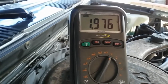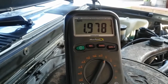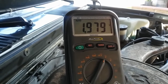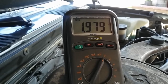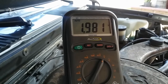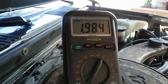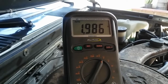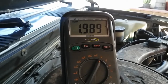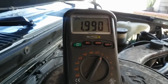That's a quick way to check if your thermistors are reading properly. Sometimes if these thermistors get heavily coated with carbon deposit, that can also affect the voltage readings because it's not allowing the thermistor to heat up properly or quickly enough. Another symptom could be a partially clogged or fully clogged EGR system that's not allowing exhaust flow — or soot flow — to pass through the thermistor, which prevents it from heating up as well. There are many variables.